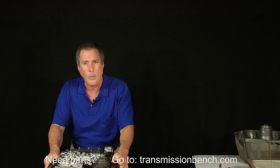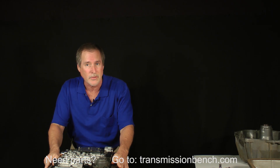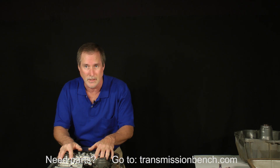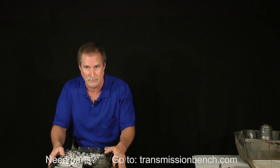Before we get started, I want to pause and encourage you to stay with this project. Some people might be reluctant to continue because they think transmission repair is too complicated and difficult. I promised in the introduction that working on a 4L60E would not be hard and that I would show you how to do it. At first, the sight of the check balls and the maze-like passages of the valve body can be intimidating, but it's not that hard. There are only 8 check balls, where they go is obvious, and you do not have to really understand how the fluid flows in all those little passages.